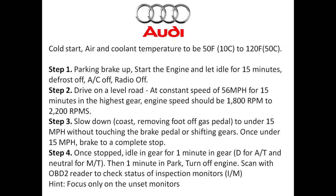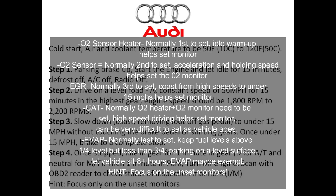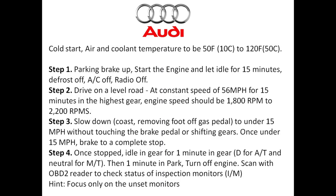As a helpful hint, only focus on the unset monitors. If you did this drive cycle and everything worked but the EVAP monitor is incomplete, complete the cycle a few more times to let it get ready. In some states like California the EVAP monitor is actually exempt, so you may be okay. If your catalyst is not ready, focus more on the high-speed driving portion on your next cycle. If your EGR is not ready, really focus on coasting in step three, and during your regular drives too — just back off the accelerator and let the vehicle coast.